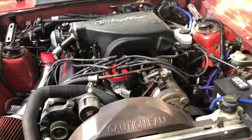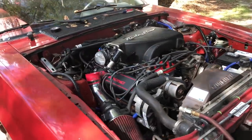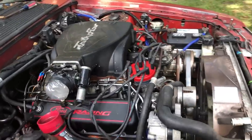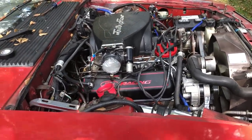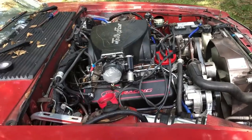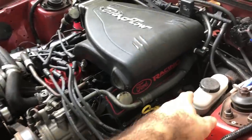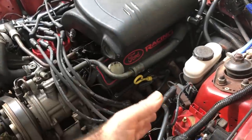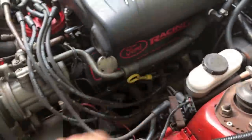I don't expect that to fix the whole problem with the car not having any power — I truly do still think that is all in the transmission. But that's awesome we at least found a leak. That'll hopefully get rid of that pop, because more than likely that's a lean pop — unmetered air that it's sucking in. That explains why this side of the exhaust was so hot, because this whole bank was lean. I took my temperature gauge and tested each individual tube — each tube was like 400 to 500 degrees, where the other side was in the 300s.